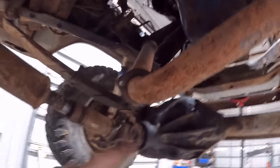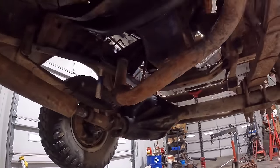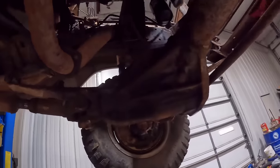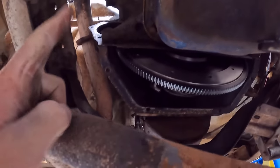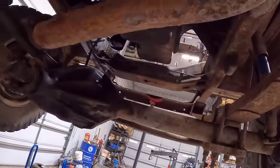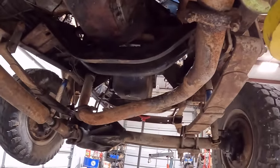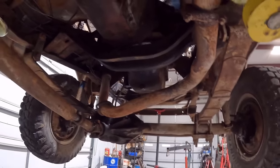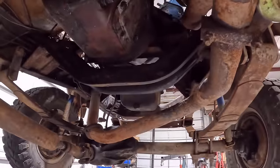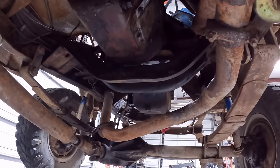I got the fuel system all taken care of. I ended up hooking up the fuel line from the frame up to the fuel pump and pumped some old gas out of the old fuel tank and refilled it, so we're pulling fuel off the tank. Under here we have a few more things to do before we can start it: I have to add the starter, hook up the exhaust, and add wiring to the starter. I don't need to hook up the clutch — we'll just put it in neutral. We just need to hook up the exhaust so we're not running open manifolds and throw a starter in there so we can spin the thing over.